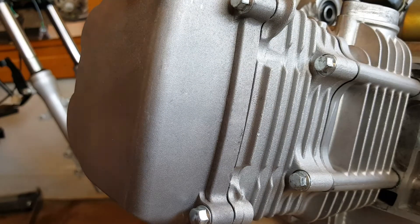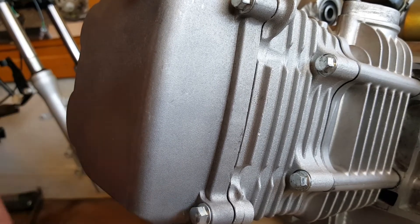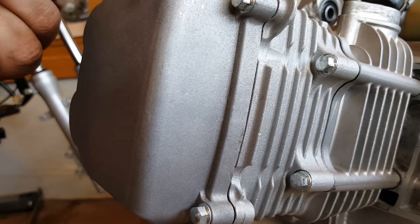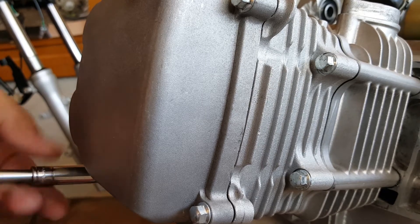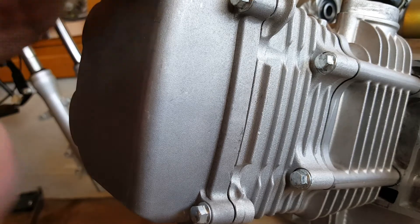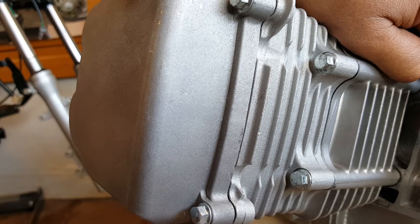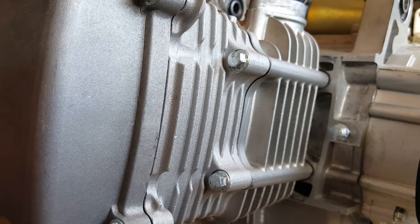So that's really cool. We're going to go ahead and tighten these down. This is going to be torqued to about no more than five foot pounds or 60 inch pounds. Just keep in mind the bigger number is for inch pounds, not for foot pounds. Remember the five foot pound for all the screws — their threads are usually not eight millimeter, they're more like six millimeter. And that's why you need to torque no more than about five foot pounds or 60 inch pounds. Then as far as the bigger rocker arm, which takes a 12 millimeter, we can go up to seven foot pounds or 84 inch pounds.